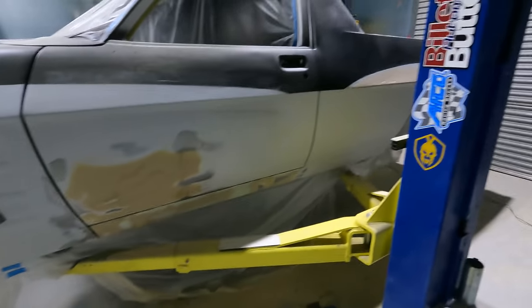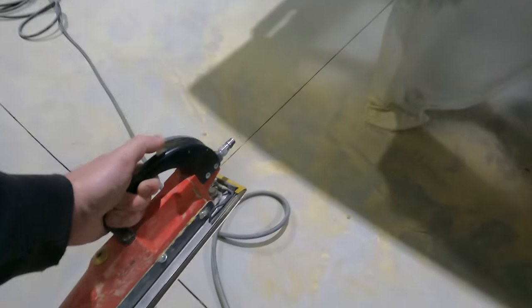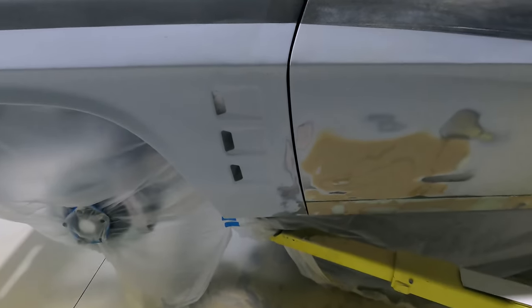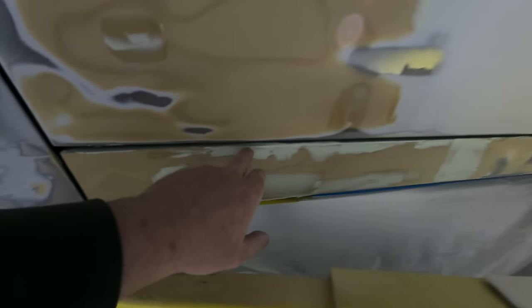Pretty much needed bog in the whole area that needed welding, and there was a rust repair section down the bottom so I had to put some bog across there with slight ups and downs. I just spent another day - I've got another sander from a mate, did a click and collect. I've just finished up here, I put some dolphin glaze on so I just need a final sand through that area, and obviously I've got to shape this corner here, round that off and around the top section. I should probably do that tomorrow and then get some primer on it.